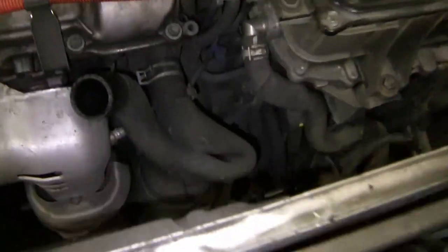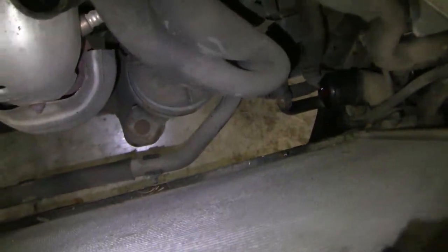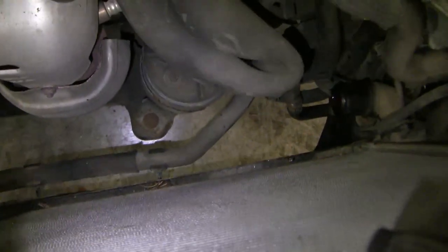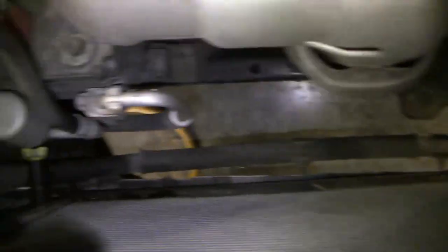Like many things in auto mechanics, there's a trick to this. Once the fan shroud and housing is out of the way, you can't just lift the radiator out because it's bolted down beneath, and you can't see the bolts very well. There's one 12-millimeter bolt on each side, and as you lift the radiator up, expect a rush of more fluid out of the radiator that was just pulled in there because of gravity.